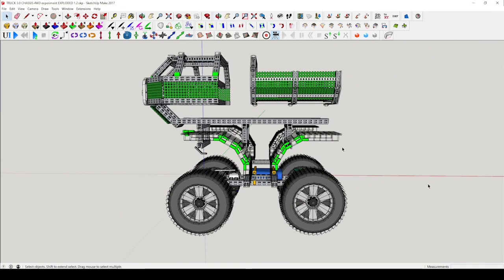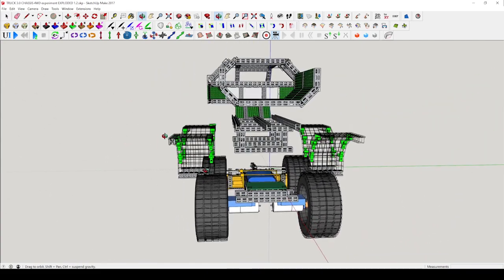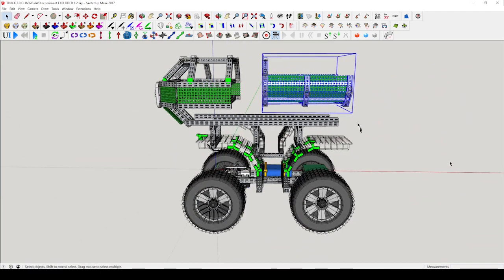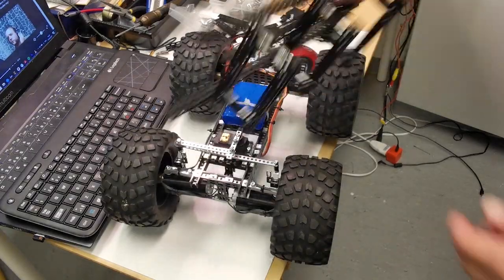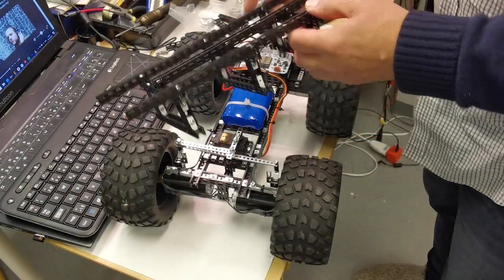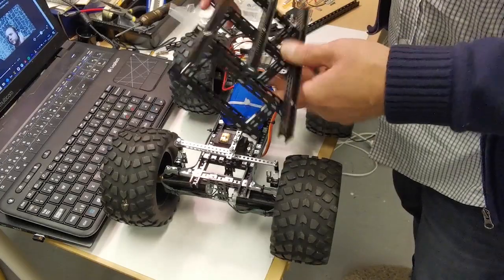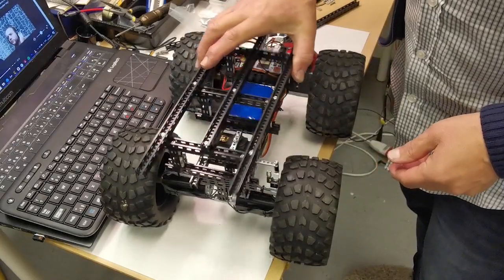The different parts of the body are made out of distinct modules that are easily put together with just a few bolts. You have the wheel guards, the connecting center frame, the loading part, and the cockpit — we'll make them one by one. Next I made the frame that connects the body to the chassis: lightweight and easy to fix the whole body with six bolts to the chassis.